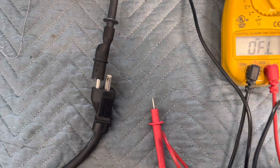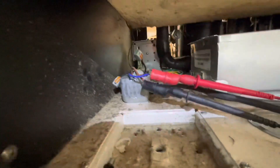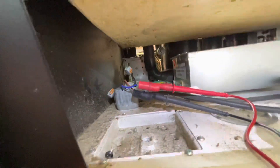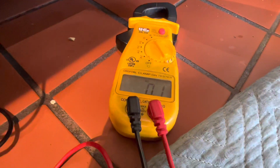Quick and easy way to check it. Customer complaint — it pops a circuit breaker when you plug it in. Let's hope it's inside the electrical box. So this is the federal. I just disconnected the wires. The blue and the brown are the ones that come from that heater element, they're just right there. So that's tone and we got a dead short. We also have — if I take one of these off of here — dead short to the case. Well, that ain't no bueno. Heating element basura.